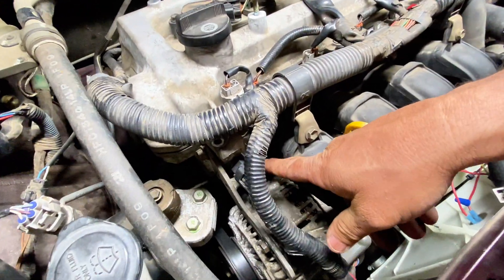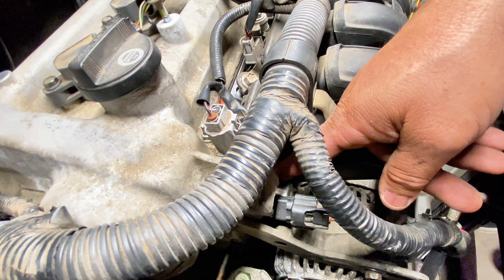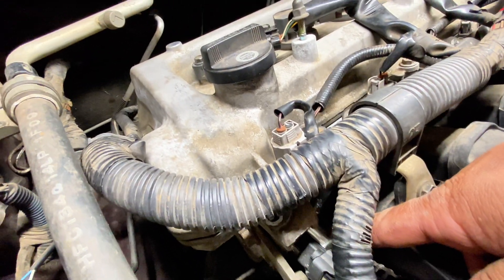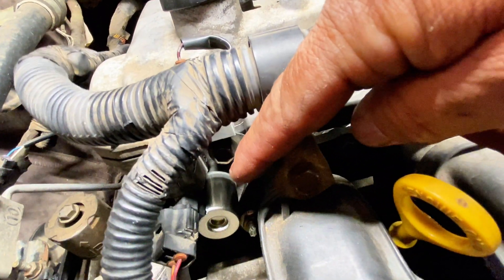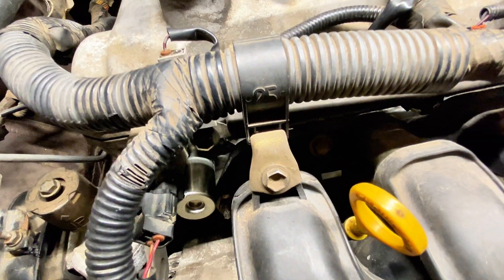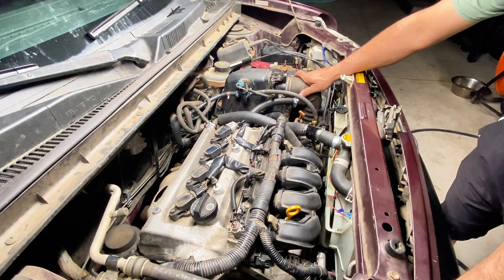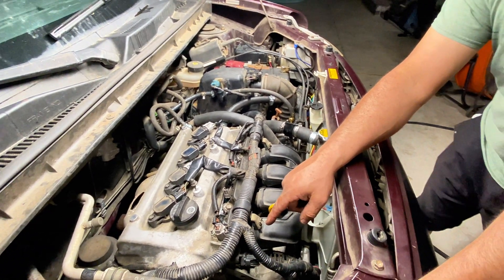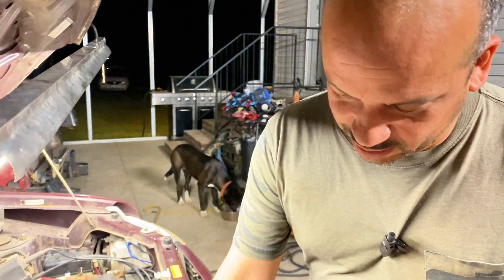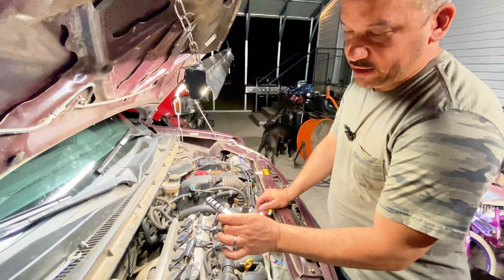When I took this head off and sent it to the shop, the Toyota one had frozen up in there and broken off. I got it cleared out and put a variable valve timing solenoid in there - just a cheap one - and I'm thinking that's probably what the problem was the whole time. So I'm going to order an actual good one and put it in there. Even though I changed out the cam and the crank sensors, I started messing with this, unplugged it, plugged it back in, and it started working. I went ahead and got a name brand one and I'm going to go ahead and put it in.